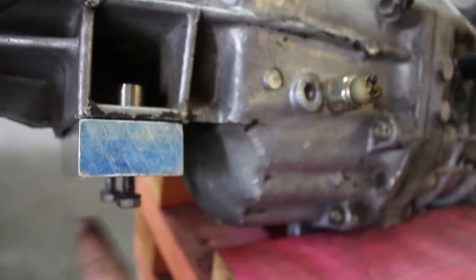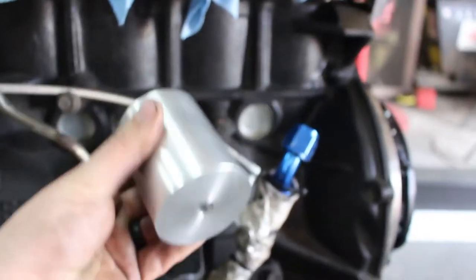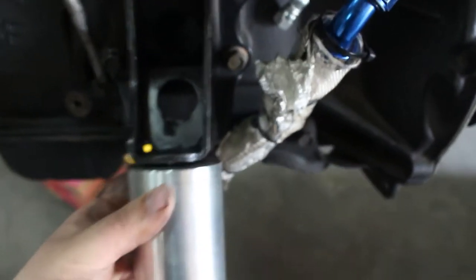I'm super excited about that. One of the deals I had to come up with is the motor mount situation. I already have an aluminum transmission mount which I'll show you right here — that mount I made basically goes to the subframe, as I've shown you in a previous video. To match up with that, I just machined these aluminum blocks. It will be a rigid mount setup in the factory location, all aluminum. I'm super excited to run them.